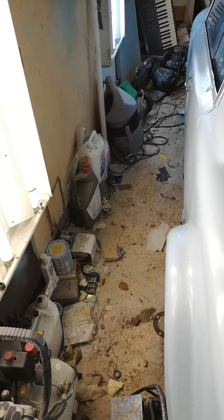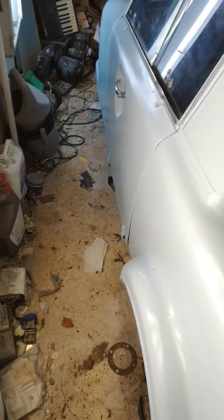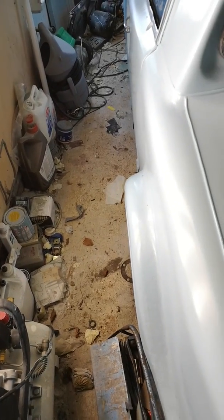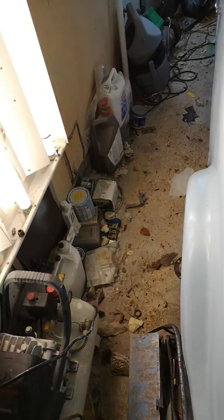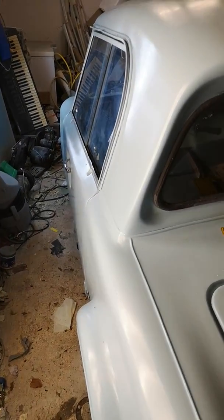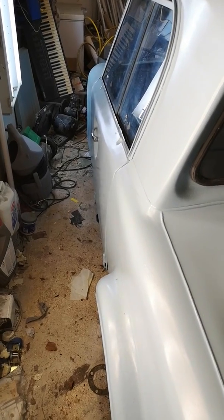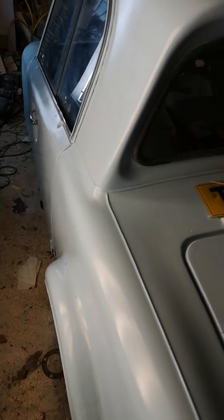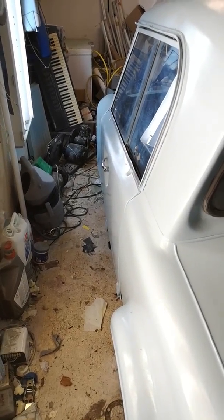The biggest challenge is finding one of the studs that came out that's sufficiently unmangled that they can use them for measurements, because even the three which did come out were fairly beat up by the time they were out of the hub. I'm fairly certain that somebody had overtightened the wheel nuts in the past, and I discovered that two of the three remaining studs were also damaged - one was quite distinctly bent and one was cracked. Luckily the ones on the other two wheels seem to be alright.